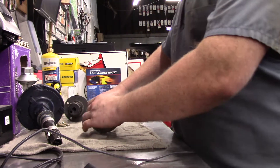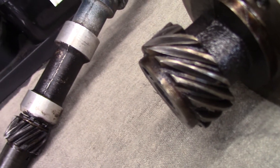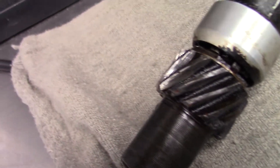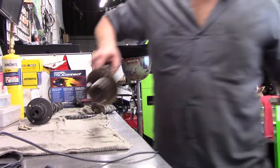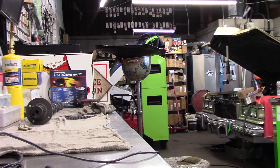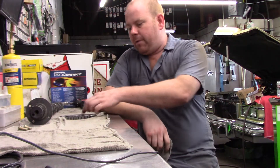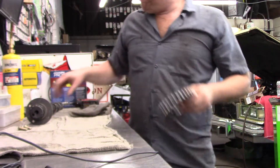You can probably see better this way — this is pretty gnarly. Check out the cut on those gears, that's pretty righteous. So we're putting a camshaft in it and obviously have to fix the distributor, which is something that troubles a lot of people. These have the nylon with aluminum cam gear; this replacement one is steel.